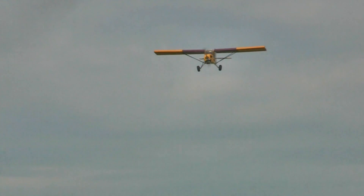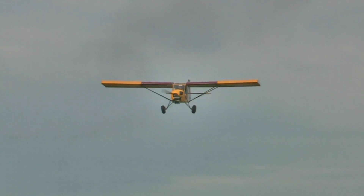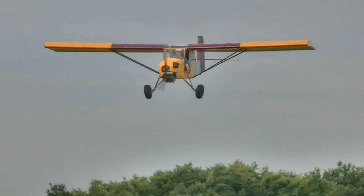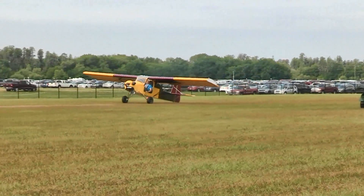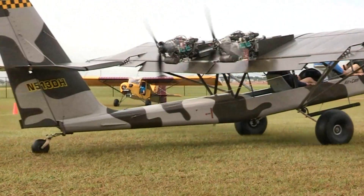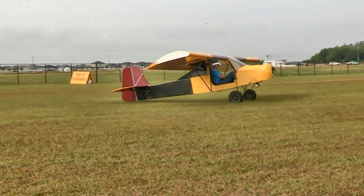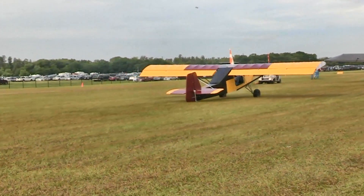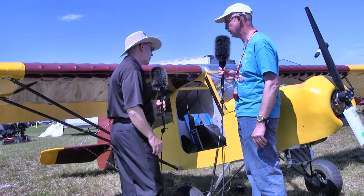The calculated stall speed is around 24 mph; the actual stall is right around 26 to 27. FAR Part 103 requires 28, so no problem there. Takeoff roll in current conditions is about 50 feet, with landing performance roughly equivalent. Cruise speed is in the low 50s with the current large tires. Fit smaller tires and faired lift struts and it cruises around 62 mph — still Part 103. With a 50-horsepower engine, expect speeds in the very low 70s.